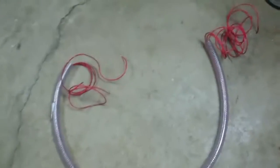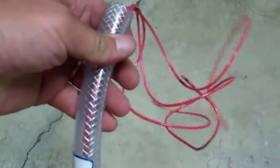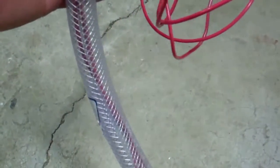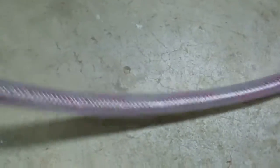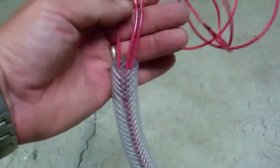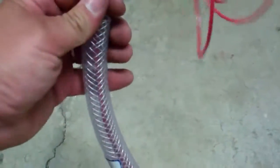I had some extra hose, so I decided to run the wiring along the bottom of the ski using it as a conduit — I really didn't like all these wires just flopping loose and I have plenty of room. Once I get everything wired, I'm going to pump the ends full of silicone and seal it off, and put as many connections as possible inside to protect the wire from heat or rubbing. I also just bought one color wire — red — which they're all going to be hot wires anyway, but it would have been helpful to get a couple different colors. I just marked the ends so I'll know which one's which.